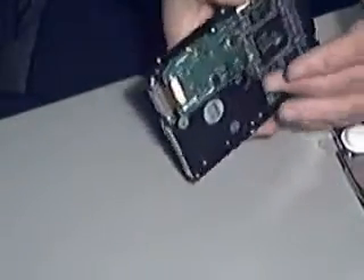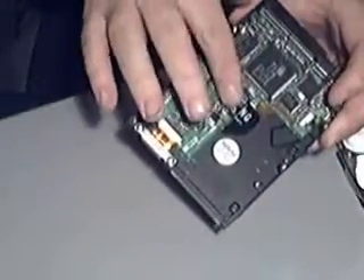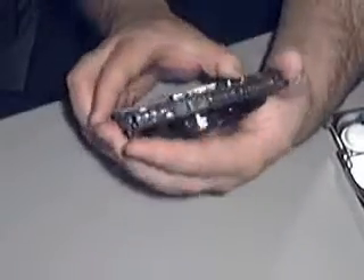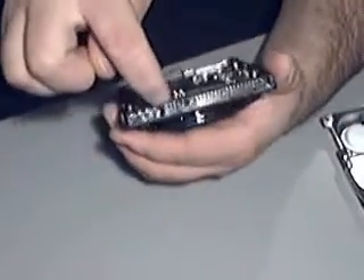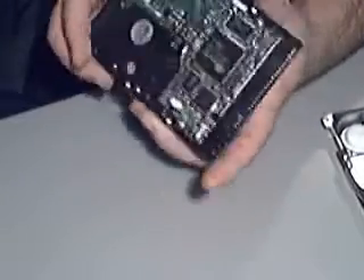Here's what we've got. First of all, you have the bottom side of a hard drive, which has the little electronics and all that good stuff on there. We have the back end, which is what you normally hook up to the computer — this goes to the ribbon cable right here. We have the jumpers we talked about last week to make it the primary or secondary hard drive, and then over here we have the power.